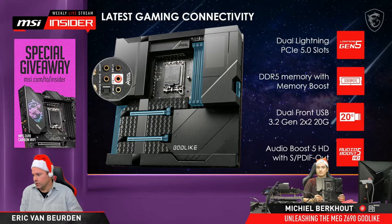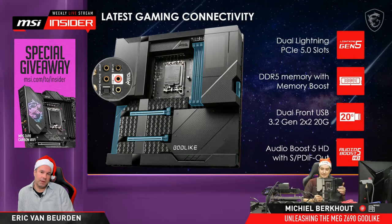But yeah, you also need to find one with two if you want to benefit from that. More and more cases with these features are coming on the market because this is a market trend. I think in the end, you will see less USB type A in the future and more USB type C. In general, I think for everything you will see more type C. Higher speeds are becoming the standard on motherboards too. And even, for example, USB 20G is always over type C. It's not officially supported on USB type A.